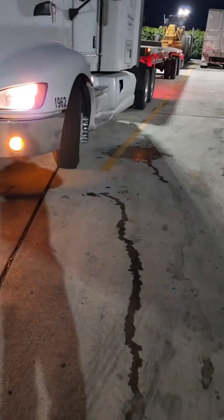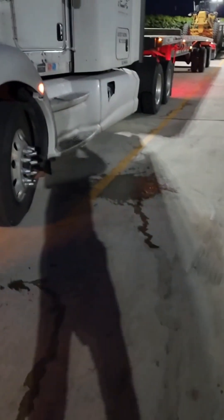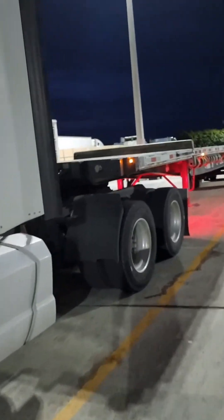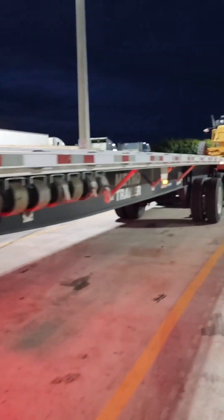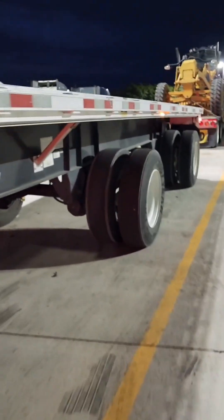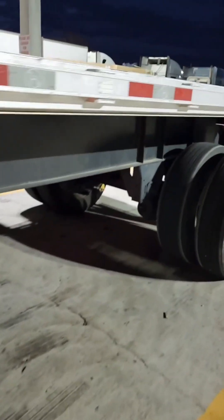So, by the time I was working on the turbocharger, this guy approached me. He said, can you help me with the brakes on my trailer? They are locked. I can't move. I'm guessing he has some problems with the slack adjuster. They are self-adjusted and they keep tightening the brake shoes.